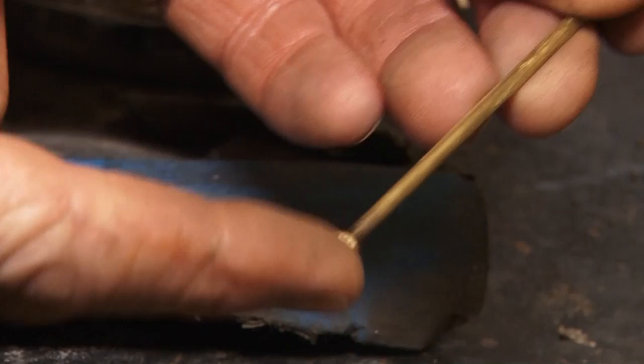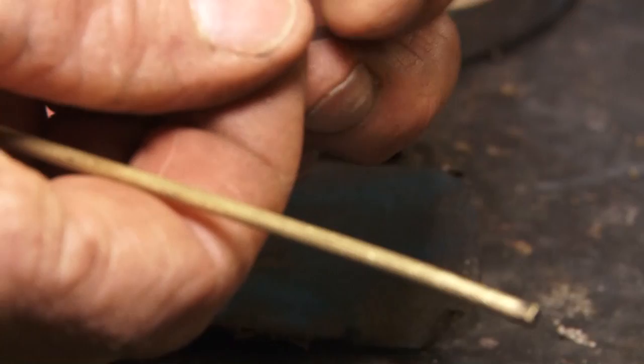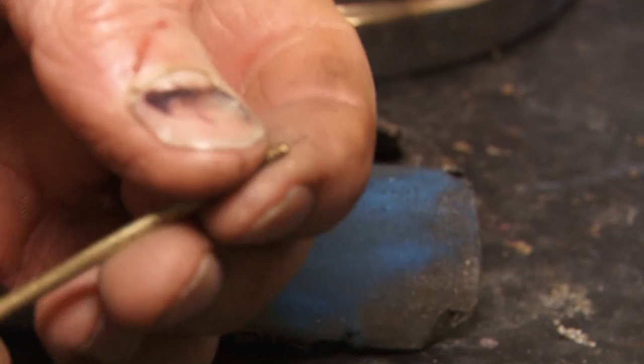You can also adjust the height of the needle with the nut at the bottom — you can see that nut there, it can be adjusted up and down like a cam effect. Let's get this cleaned up. I've got this main shaft of brass — cleaning it up with a bit of fine emery paper. Just be very careful of that needle at the top. You can take these out and replace them generally as spares. It's probably best to take that output to one side before you clean the end of this and get that carbon off.